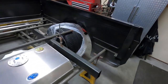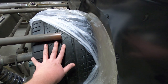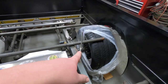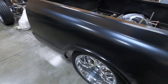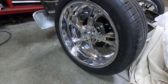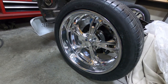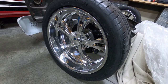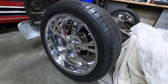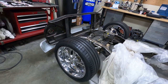You can see how wide the rear tires are — they are massive. He could have gone wider but justifying the tires to fit was already difficult and very expensive. In the front he is running 20x8.5 US Mag Cartel Fives with a 4.25-inch backspace and a 255/40/20 Michelin Pilot. He may go down in tire size in the front to get the low stance he needs and proper turning radius, so those may end up changing.